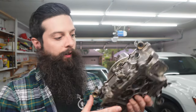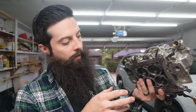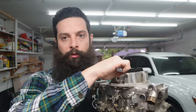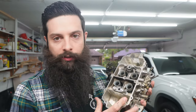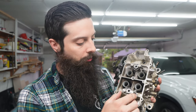So finally I found this post, which I will link down below. I tore the 600 down to rebuild, but they're all constructed the same with this unibody design — you just pull the top off with these screws. And if yours has an electric choke, you've got to fiddle with that a little bit to get it off. But you can see both bowls here — primary and secondary — and the boosters just sit right underneath with one screw that goes through here.